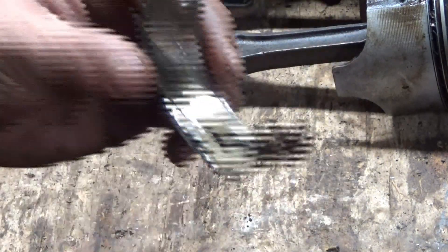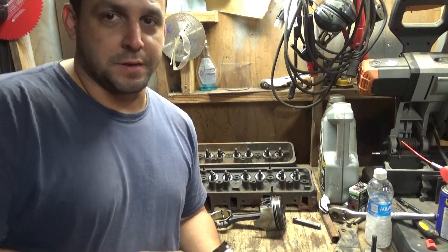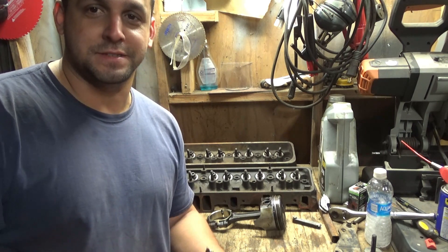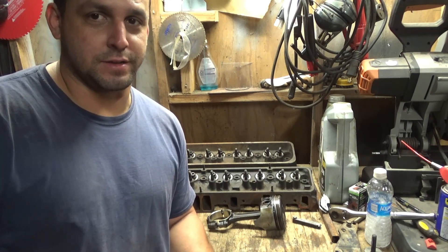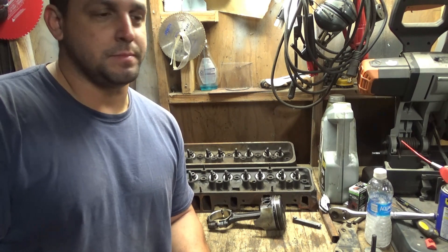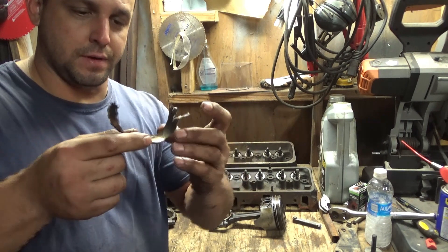The reason I noticed this — I've only seen this a few times on maybe three or four different engines in all the years I've been messing with this stuff. The reason I jumped straight to number eight is because I was rotating the crankshaft to get the pistons out and I noticed it chirping, making a little chirp noise. The only time I've heard that before was on a truck engine that was running going chirp chirp chirp. You could tell the engine was trying to lock up, and when they took it apart it had bearings that were overlapped like this.